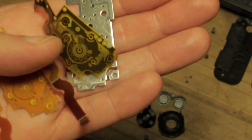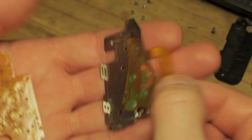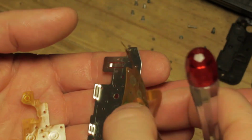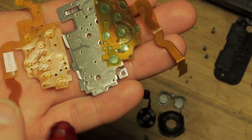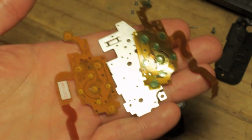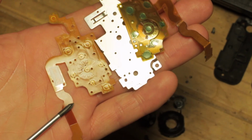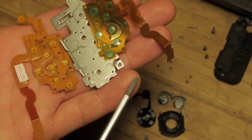But clearly this is not something that you want to be taking on and off the plate at all, unless you need to replace it. And the back is not something you want to be taking on and off unnecessarily, and when you do, you need to be much more careful than I was with regards to reattaching and removing the ribbon cable and trying not to flex it and straighten it so much.